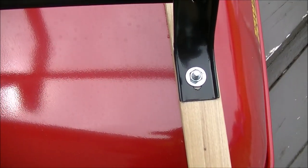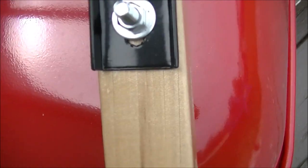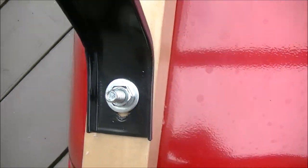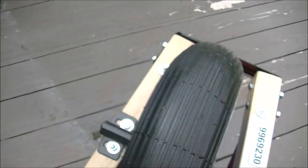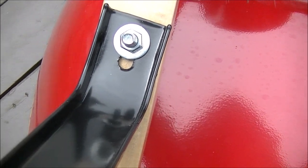The leg section of the wheelbarrow was torqued down. Now as you can see, you look at the space between the washer here and the metal of the leg — it's the same distance on both sides. I've also tightened up on top this extra kick leg, put the extra bolts here, there, and on top. And again, look at the spacing here and there — and that's equal. So the legs are tightened.